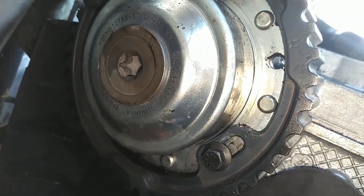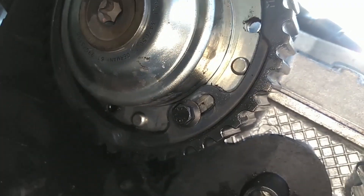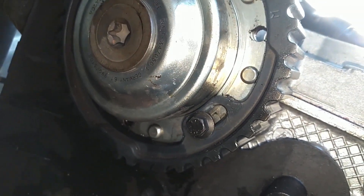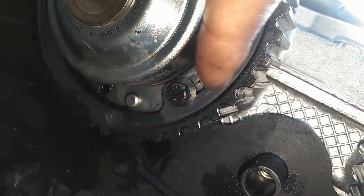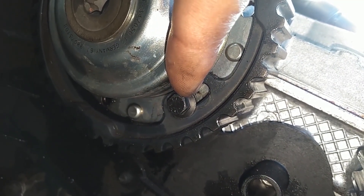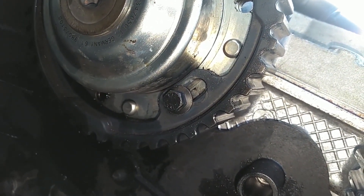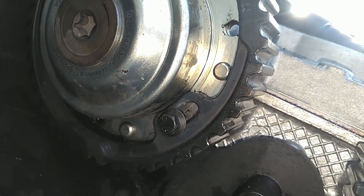What you want to do is take all three of those screws loose, put a T55 in that there, and turn that T55 in this hub counterclockwise a little bit so that the screw slides back in the slot toward the back where you see that old mark is. That will retard your timing, and then tighten those three screws back down.